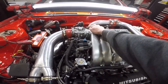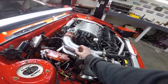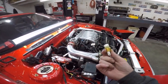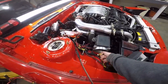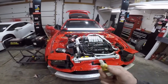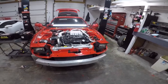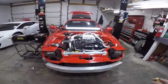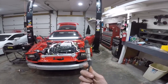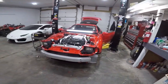You can tap into a vacuum line after the throttle body for the MAP sensor. The temp sensor comes with a bung you can weld in — drill a hole and screw it in somewhere to measure intake temp. I'm not going to do a permanent install right now since I want custom intake pipe eventually — I'll just give myself extra wire to get close enough for now until I can get intake pipe made. Tuners say it's not a big deal if the sensor is near the air filter — not much of a difference. Also, the wideband O2 sensor was bad right out of the box, was reading everything as lean when it was obviously rich. Got a new one — everything's good now.